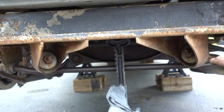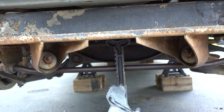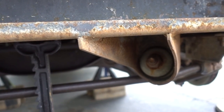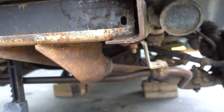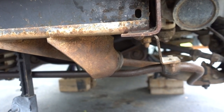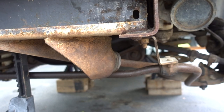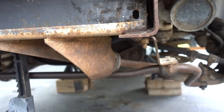Because Greg can't focus or concentrate on anything today, we are rapidly bouncing around the first gen. We've got another drive pin in these little nuts — these bars have bushings in them and they tie into the front sway bar. I got all new bushings for these, so we're actually going to drop that down and change those bushings out.